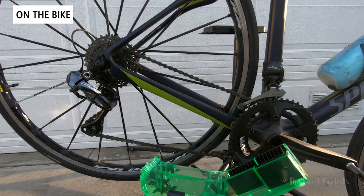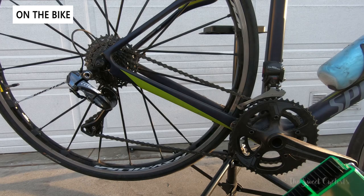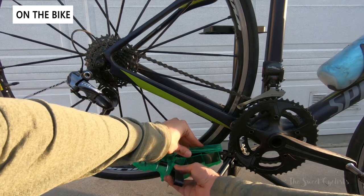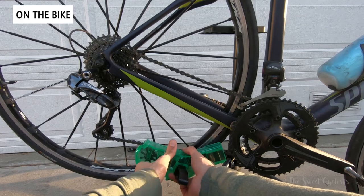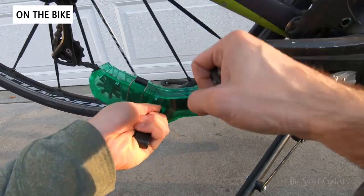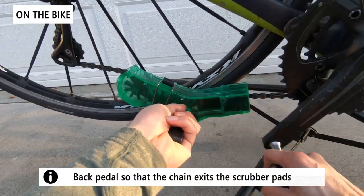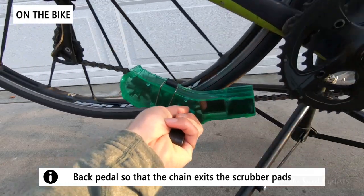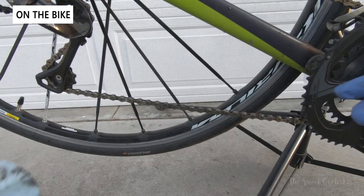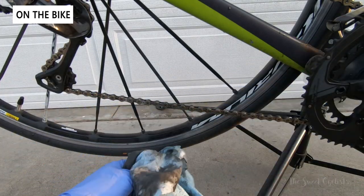Once you've hit that fill mark, you can put it on the bike. Take the top pieces off, place the cleaner on the chain, and drop it down over. In action, it takes quite a bit of force, but you can see it starting to clean through and all the gunk collecting in the bottom. After a little wiping down, you can see all that dirt and grease just wiping right off because we've already brushed it with the cleaner.